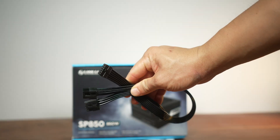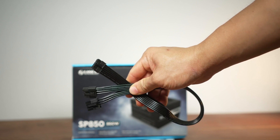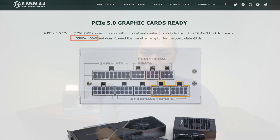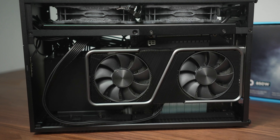So why is this all relevant? Even though theoretically this single 16-gauge cable should be capable of 600 watts, and Lian Li says this is ready for the next gen of PCIe 5.0 cards, this power supply itself is not ATX 3.0. As such, it just has those 12 pins for power delivery without the sideband connectors, and because it doesn't have that communication capability, this essentially functions as a two-by-eight-pin connector to 12-pin adapter cable. This means it can only be run with cards up to around 400 watts.